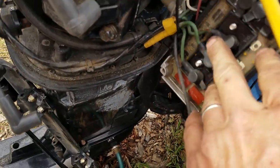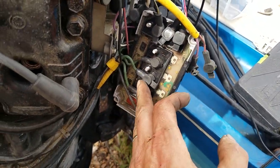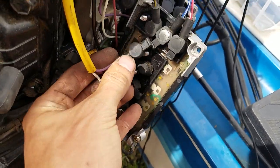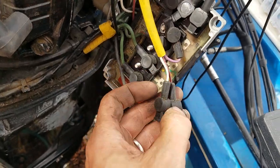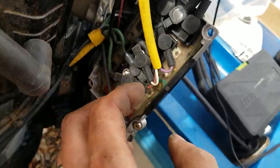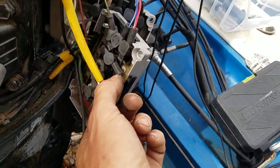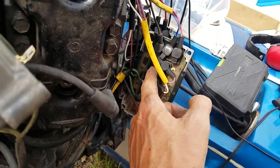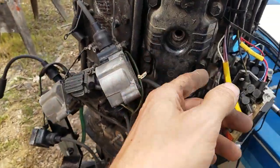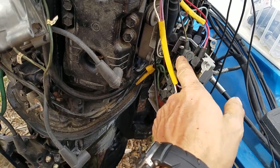On some of the smaller HP motors they've actually cut the wires too short for you to make a mistake. But you can take the pairs — there's violet, there's white, and there's brown. These two are paired, these two are paired, these two are paired. You can move them around, just make sure the outgoing wire matches the cylinder number that matches the color of the incoming trigger wire. Then you can test the channels — I've had some of these work on two channels but the third one's blown. So change these, change your plug wires, run the motor, and use an open gap spark tester or at least a spark indicator. That's how you can figure out if one or more channels is bust without special equipment.